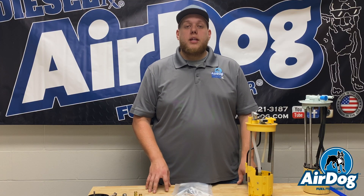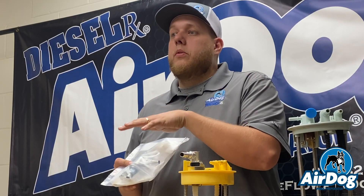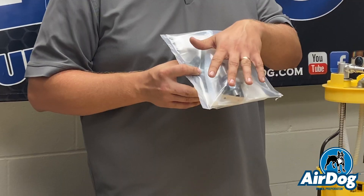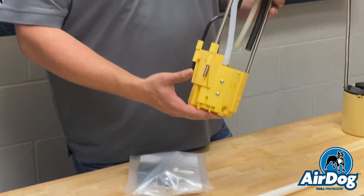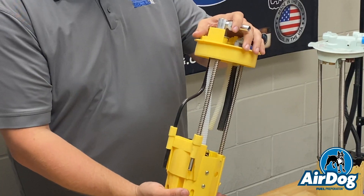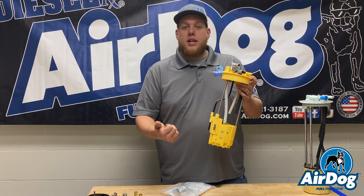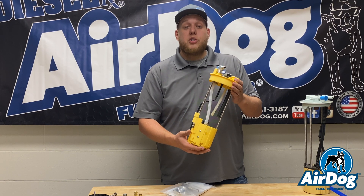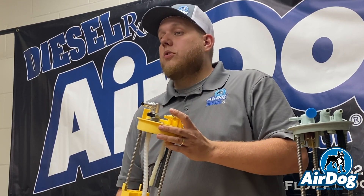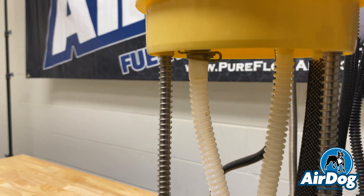If you purchase an AirDog 2 kit, depending on the application, you may receive what's called a fuel module upgrade — on your second gen and newer Dodges. Some early second gens do not have an in-tank pump, but this is going to be installed if you have an in-tank pump in your module. What a fuel module upgrade does is remove the fuel pump from the module and add a half-inch draw straw internally. It still allows for the springing of the module and basket fill, keeping fuel around the draw straw so you don't have to worry about quarter tank issues — a bit more seamless integration since you're not putting a hole directly in the tank, you're putting it in the fuel module. It can always be replaced if you decide to keep your AirDog for your next truck — swap out the module and it's all back to stock.